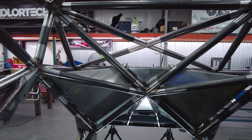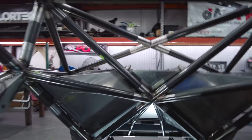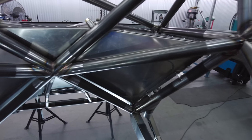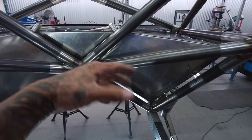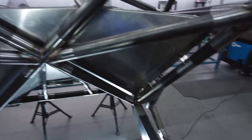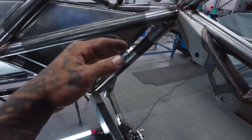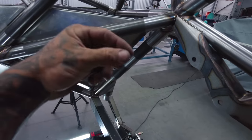You can tell there's a fuel cell can in there now. One thing I mentioned was seam saddles — when you're building a fuel cell can or building around a can, you want the tube or chassis structure to be a support system for the surfaces of the can, so if there's fuel sloshing or hammering at compression it's not blowing into free space and blowing your seams out. On the sides, we have isolated floating saddles — broke 90-degree, 90-thou chromoly — that help that seam resist splitting from repetitive bladder impact.